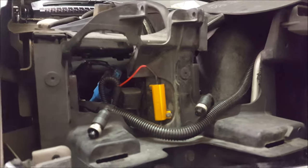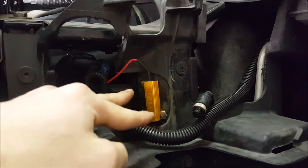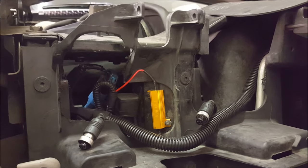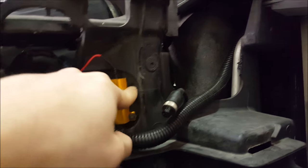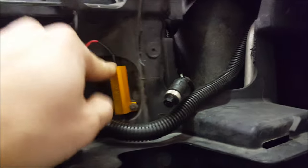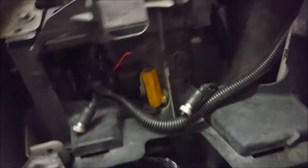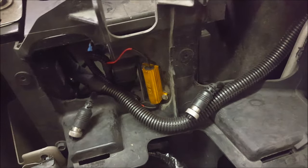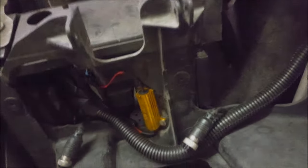The front load resistor was the culprit, so I changed that one out. This is the original location, and the nice thing is because the designs never changed, I was able to reuse my holes. It's right here on the metal subframe for the radiator, so it doesn't get too hot near all the plastic. You can also see my ballasts for my LED HID setup. I don't like seeing ballasts just zap-strapped in with junk everywhere — guys, take the time, take the vehicle apart, and mount everything properly. Your stuff's going to last a lot longer because it's not banging around in there, and it just looks better.